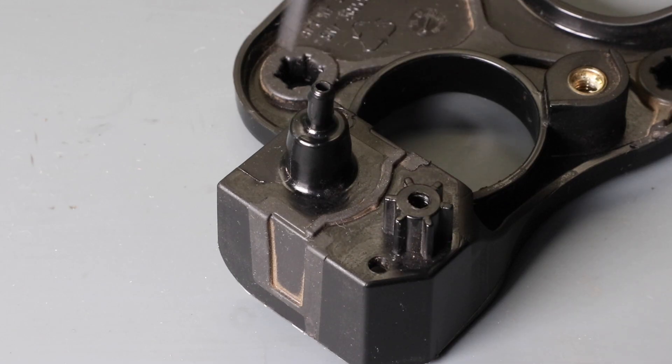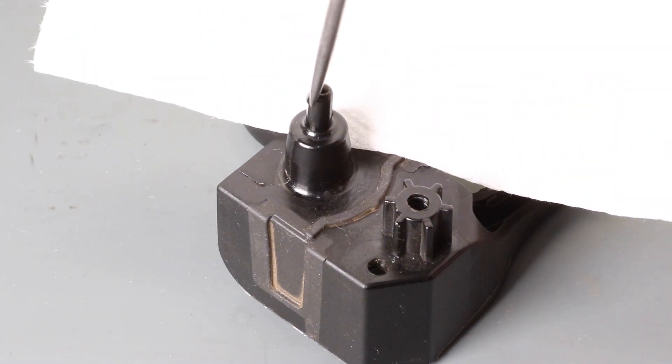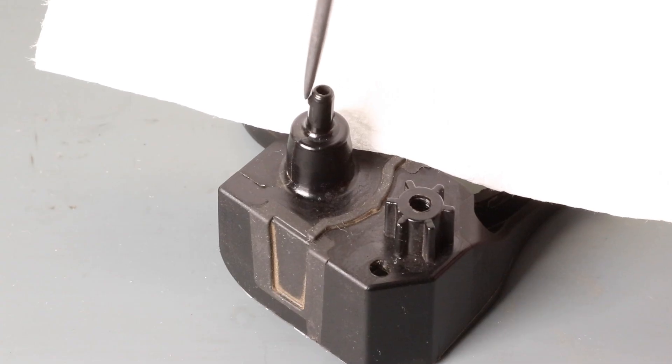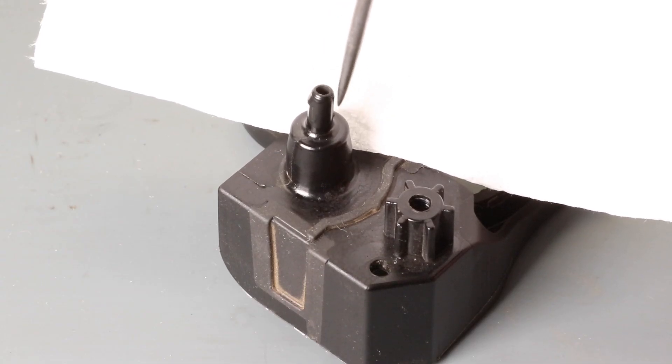What's not so good is the hose fitting itself is actually bent. I don't really like that. Also, there's a barb molded in, but the barb only goes half the way around, or a third of the way around. So this area has a barb, but this area has no barb at all. I'm not sure how well that seals — not very happy with that.